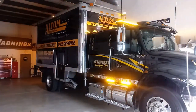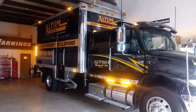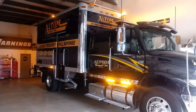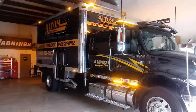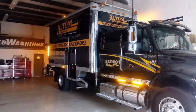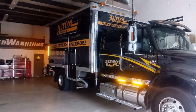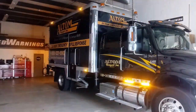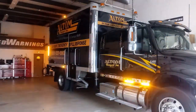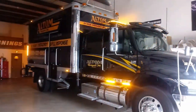We've got quantity four Thin-X strips on the back — two facing sideways on the box and two facing backwards on the box corners. We've also got two-head Wicked Sticks on the back of the box. This was built to spec to flash all amber; we didn't want to do any white, so we've disabled the white flash on the Thin-X strip as well as that front bumper. We synchronized the top of the box to flash middle-outside and synchronized the bottom to go along with that. The driver's side is done exactly the same as the passenger side.